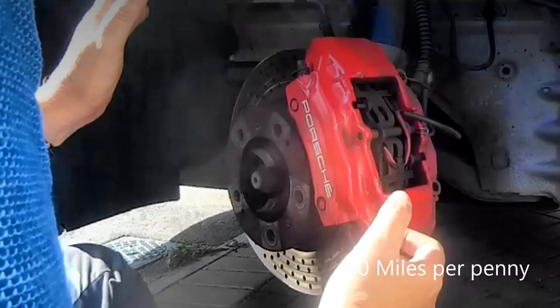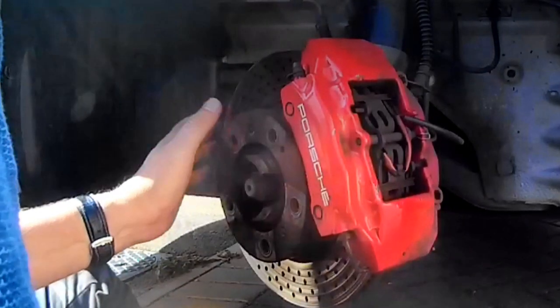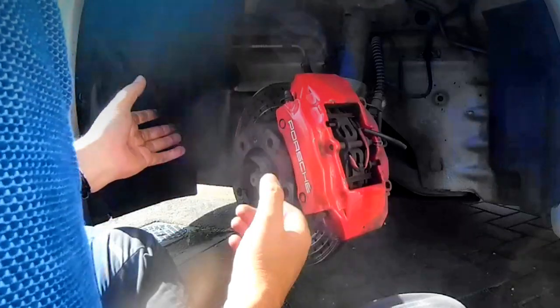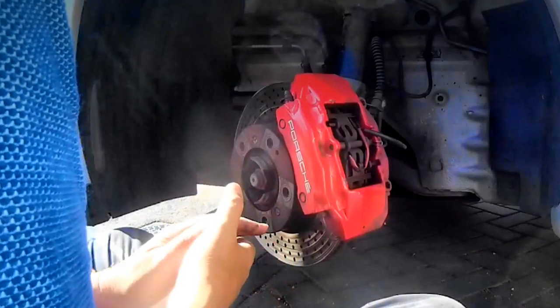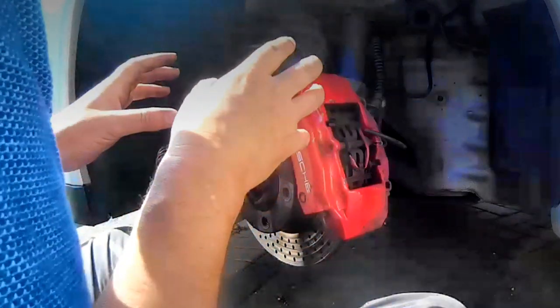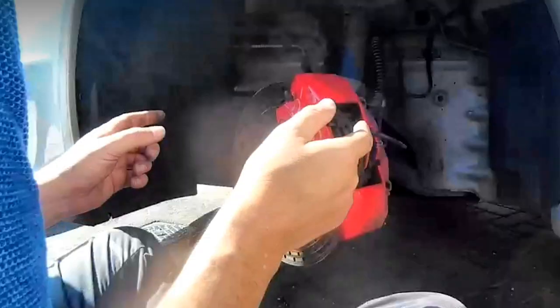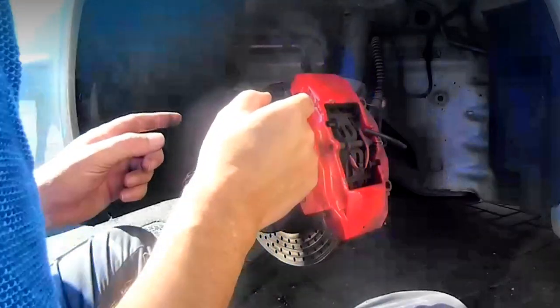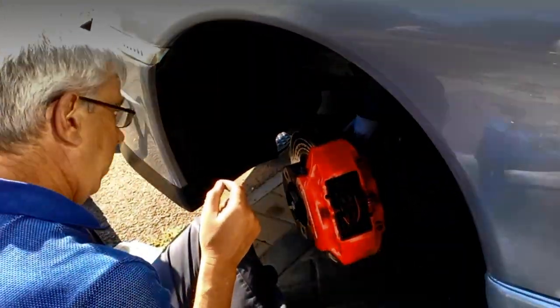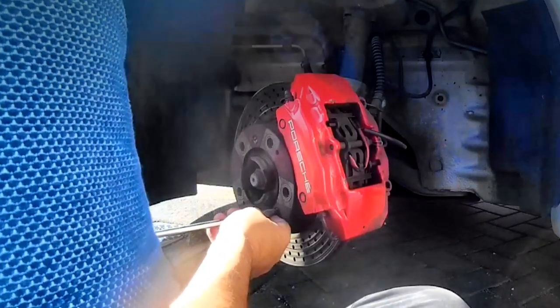As you can see I bought discs for the front as well. I don't know why, but the front discs are worn quite badly. Normally I wouldn't expect to replace discs, but in this case we're going to have to. So the first thing we're going to do is loosen off all the bits first before completely undoing them, because if you start undoing bits it can make it awkward to get the other parts undone. We've got two screws on the disc here which we'll get undone.